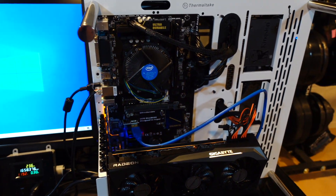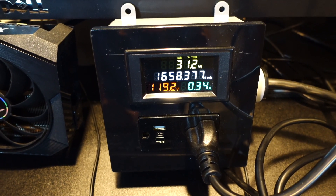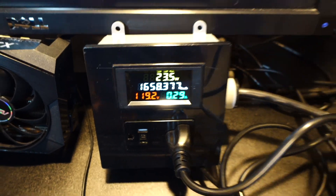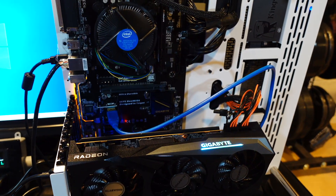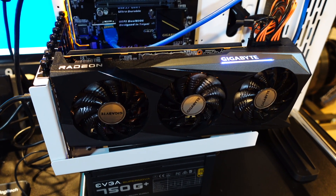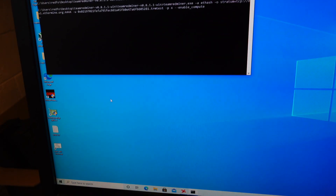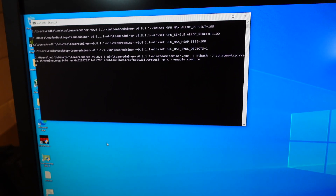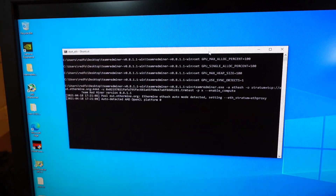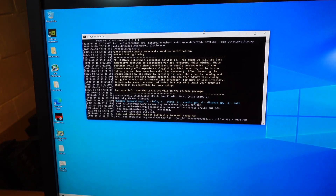Anyway, this is the test bench I have set up here. The first thing we need to do is look at our idle wattage, which is around 30 watts — what this test bench pulls while it's not mining. That's gonna be important as we get to the efficiency part of this 6700 XT. The first thing we're gonna do is see what it's made of — we're gonna run it stock. So let me go ahead and start Team Red Miner, and we're gonna let this GPU tune and mine stock with no overclocks, haven't touched anything.